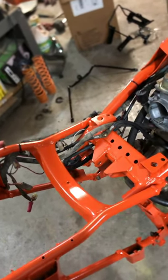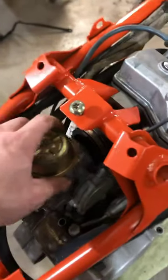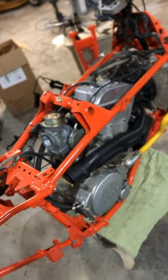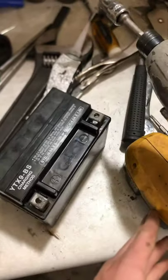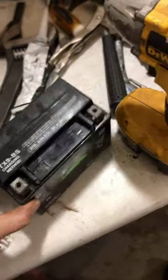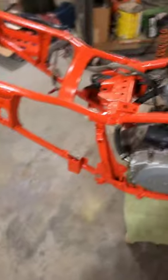That'll be all the wiring done. Still got the exhaust pipe left, the air filter stuff, still got to set the carburetor on there, then the gas tank, and then all the fluids. Then I think it should be ready to fire. Got the new battery right here — just got the electrolyte added to it, so I just got to put it on a slow charger for about four hours and it'll be good to go.